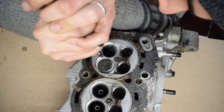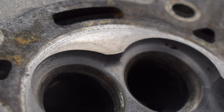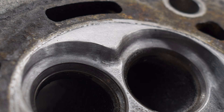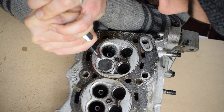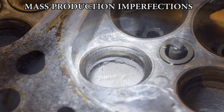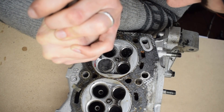I'm starting by working on the combustion chambers. This is the only area of the cylinder head that I will be slightly reshaping, while everything else will mostly be just removal of casting flash and smoothing out rough surfaces, sharp angles and edges that are a consequence of the mass production process. When it comes to porting and polishing in general, the greatest gains are actually achieved at this early stage of removing mass production imperfections.